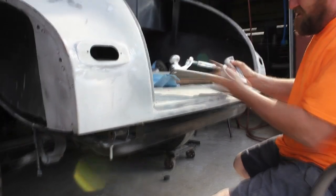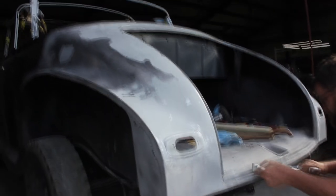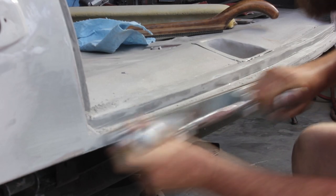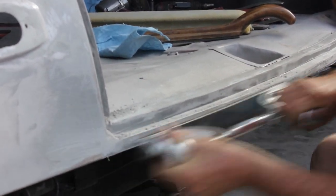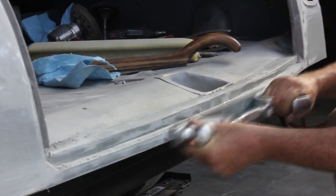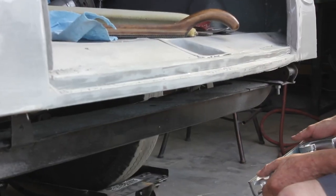If you're doing this, see how my file's kind of curved — I match the file to the curve. I'm walking down this area, filing all along here. We've been on this all day. I've been doing a lot of sanding on it and it's been going really well. Now, regular body putty and stuff like that just won't sand with a metal file. It'll gum all off and turn to nothing in a metal file.